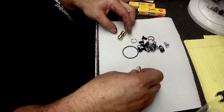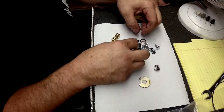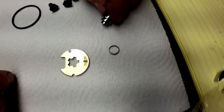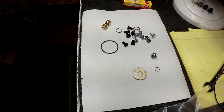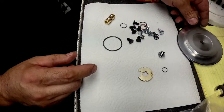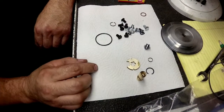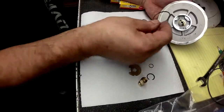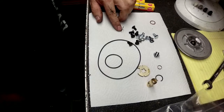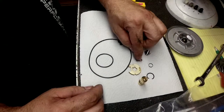When we're rebuilding a turbo, this is the outer bearing support and this is your outer bearing. This sits in the compressor housing interior plate. There's an oil seal that goes on here - this little guy. It's not a conventional oil seal, it's more like a piston ring - a compression style seal and it seals inside. This housing is actually one that's installed right now; that supports the end of the turbine shaft. From there, we put in a new snap ring that holds this bushing in, and this is a new bushing for the turbine shaft. You get a new o-ring that goes underneath the housing - it sits in here. We also have one for the outside for the compressor housing as well. And then you get a new turbine oil seal as well. This one goes on the back side on the exhaust side of the turbine.